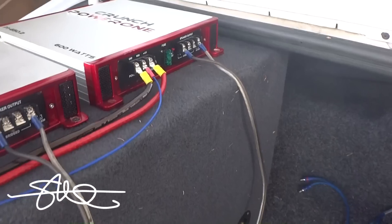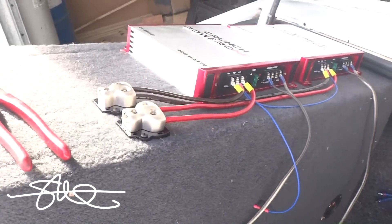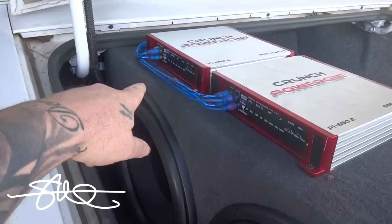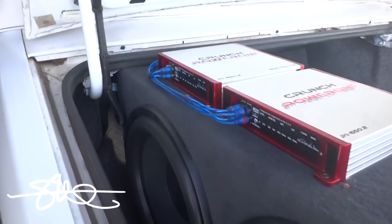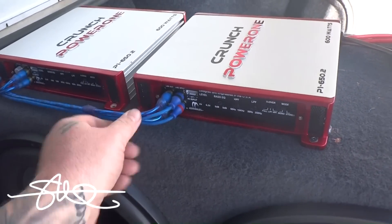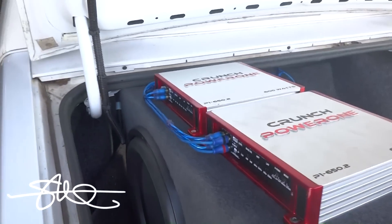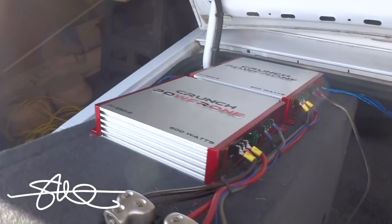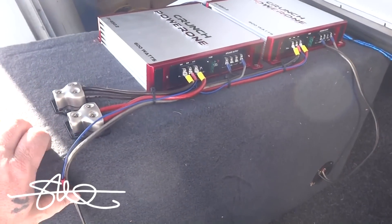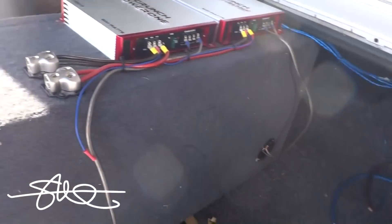Got some brand new Rockford Fosgate wire all the way around - speaker wire, power wire, everything. Should be ready to hook up in about 5 minutes. So basically what I did was I've got some Stinger RCAs from the junk box that were blue - they matched his original blue ones, so now he doesn't have the mismatched ones anymore. Well they are mismatched but at least the color is pretty close. Positive, negative, remote - brand new Rockford Fosgate speaker wire and terminals. All I've got to do is hook up his original 4 gauge to those terminals and we should be ready to play. I've got to set the gains too.